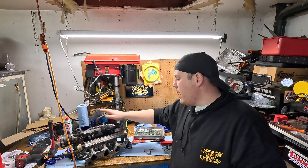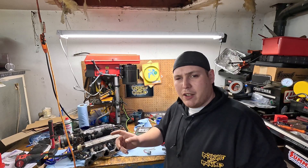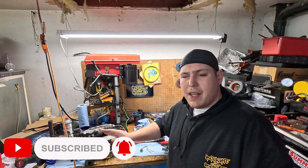You're also going to need an intake manifold so we can run the two-wire style idle air control valve — we went ahead and picked up a pigtail for it. We're going to fire up the Honda, run to AutoZone for an intake manifold gasket, then pull it in and get everything swapped over.